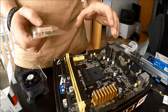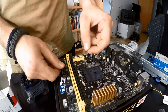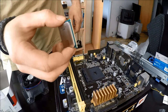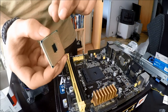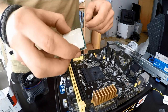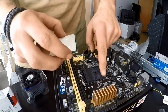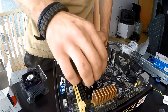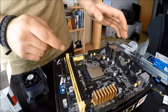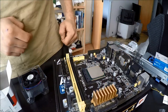Let's get to assembling our motherboard. The first thing you want to do is lift this little arm up right here, then you take your processor out of its packaging. Now you want to be very careful not to bend the little pins because if they bend your processor is pretty much toast. To line up the processor correctly there is a little triangle here and down in the corner there is also a triangle — you want to line those up. Don't force your processor in, it should fall in just on its own. Then you just want to close this up and your processor is installed.